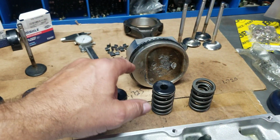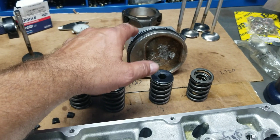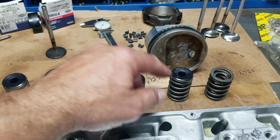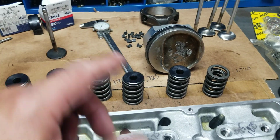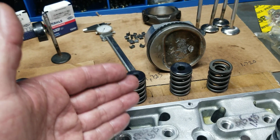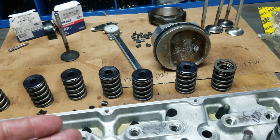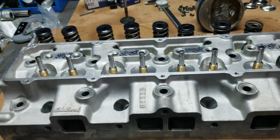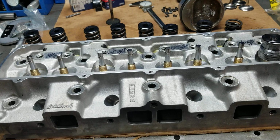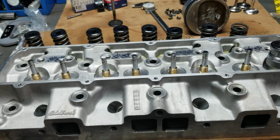Debris got down into the engine here, so even though these are brand new pistons, there are scores, because typically what happens is it will take the head of the valve and shoot it across, and the debris will transfer from one cylinder into the next, and that's not good. So he'll go the next 10 thou over. This was 4155, and now it'll be at 4165. We'll get him a new set of pistons. He's got the block at his local honing shop that did the hone and the washing of the block originally. So we'll get him back together, and he'll be happy, and I don't think he'll make that mistake again.